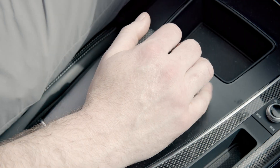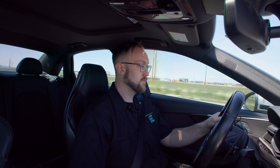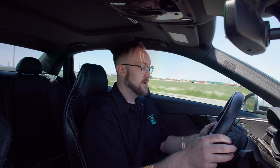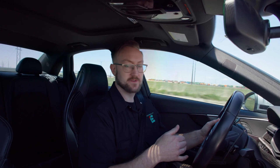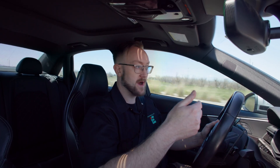When using rolling anti-lag, the car must be in manual mode and traction control all the way off. Bring the car up to a desired speed and then downshift to get the RPMs higher. Rolling anti-lag will be engaged by the cruise control stalk. You must be between 5% and 75% throttle input before pushing the cruise control stalk forward. Push and hold the cruise control stalk at the first soft stop — if you go all the way forward to where full cancel clicks, it will disengage rolling anti-lag.